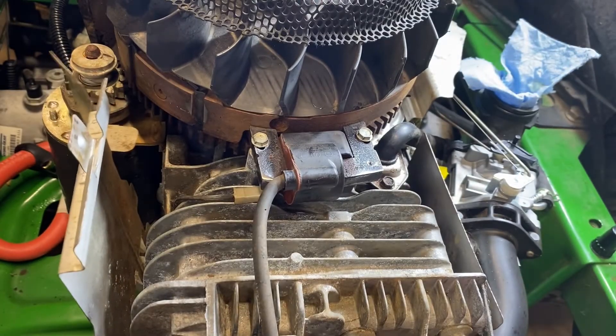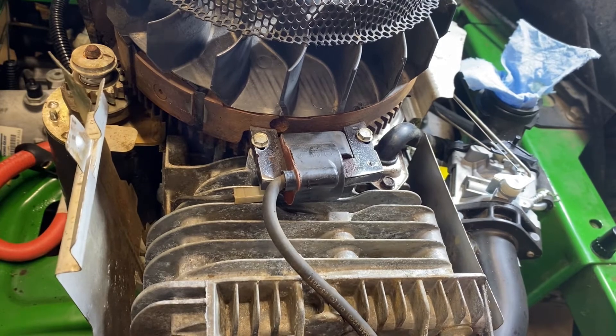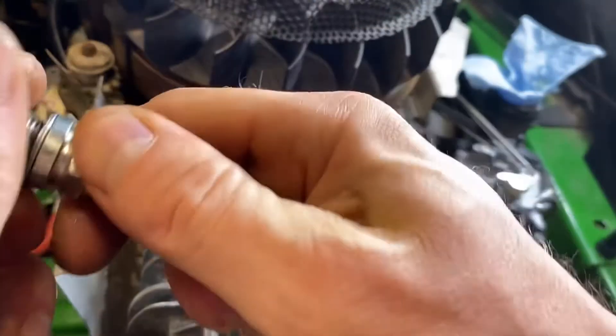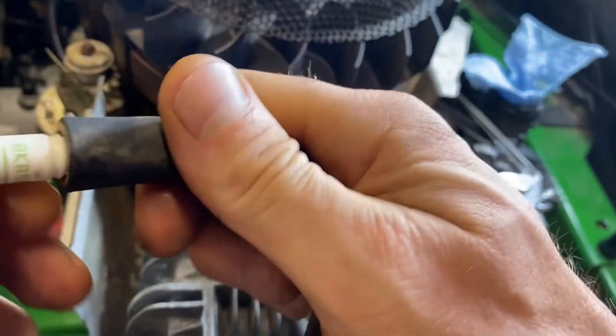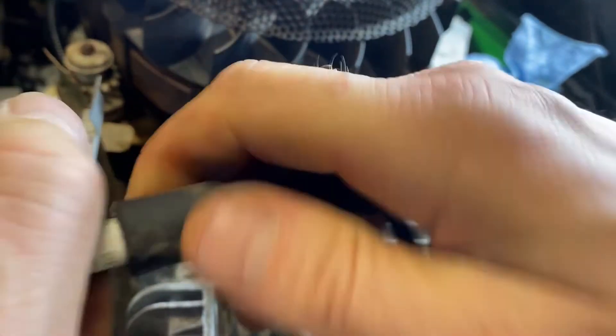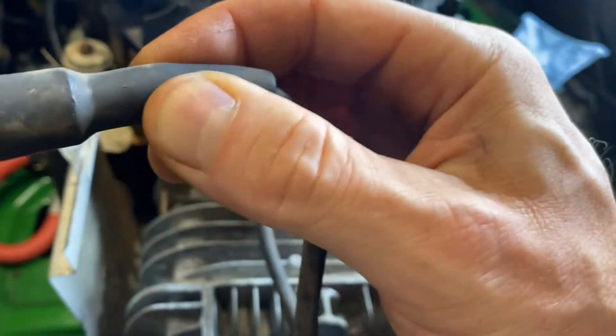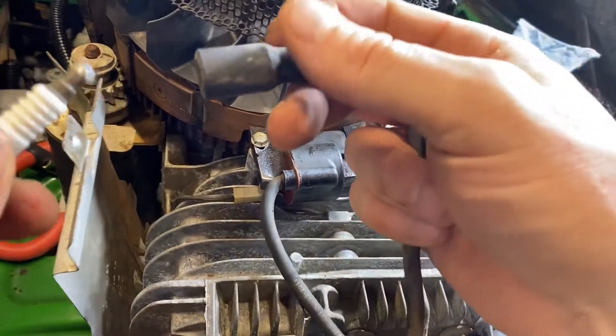So you've got that sucker hooked up. Let's go ahead and test it — see if it does any better than before. When you pop the spark plug wire on, make sure you feel it pop. When you just set it in loosely, that's not good — you want to feel it go pop. If it doesn't, try to bend the connector a little tighter with pliers. Also, I like to put just a tiny bit of dielectric grease on the tip of the spark plug wire — just a little bit, don't over-lube it.